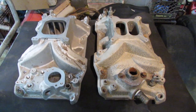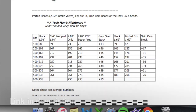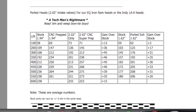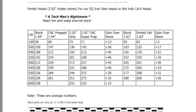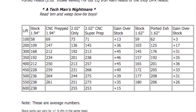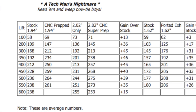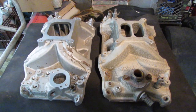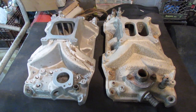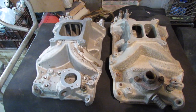The reason I chose this combination: I don't need much more lift than I have because I looked at my heads online and I believe Hughes Engines actually did a flow test on them. My heads have 202 valves. I'm going to hand port them and get a competition valve job done. At around 500 lift they flow around 244 CFM as-is, and at 550 they're kind of maxing out at 251 CFM. At 600 lift it's 255 CFM — so I'm not gaining a lot by going to a much larger lift cam. I'm kind of in the sweet spot at 525 lift, matching those components up.